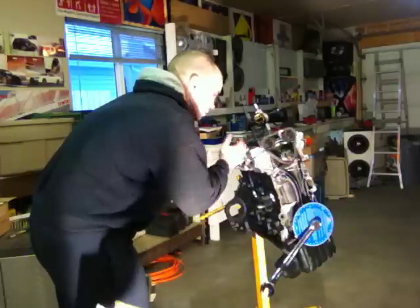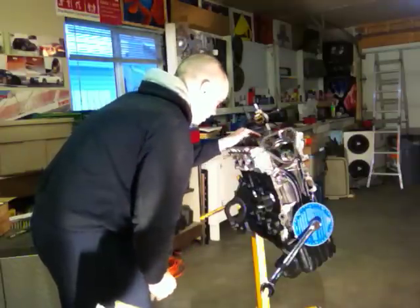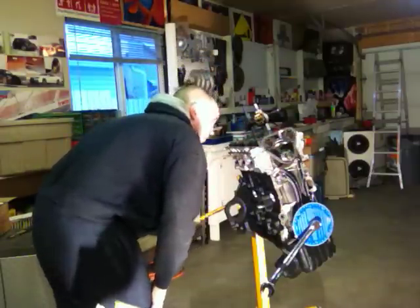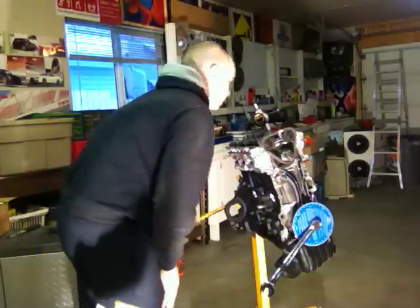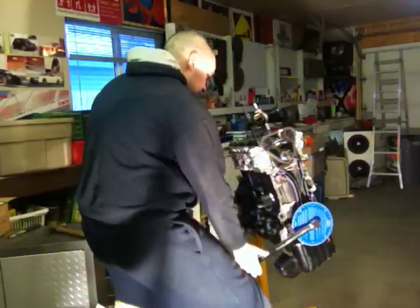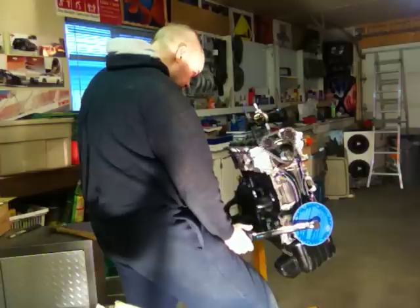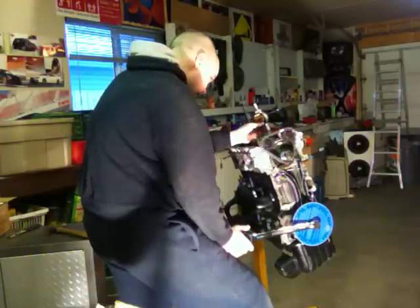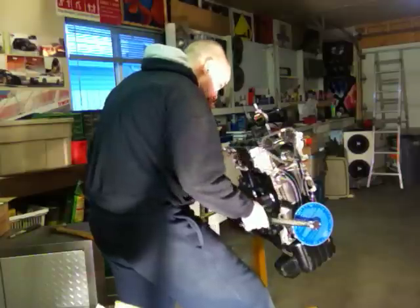I've already done a video for the intake. Now I'm going to zero my gauge out because I've preloaded it a little bit sitting on the exhaust side. It doesn't look like it's going to hit the cam lobe itself when I turn it over. This is now just after the compression stroke, so I'm going to zero it out again.